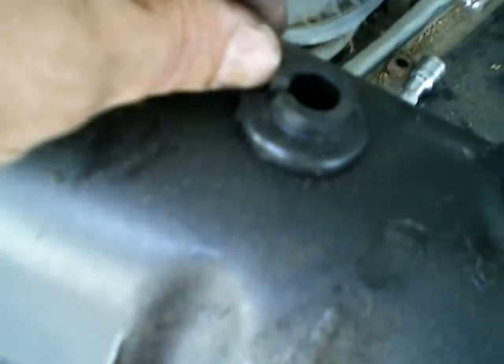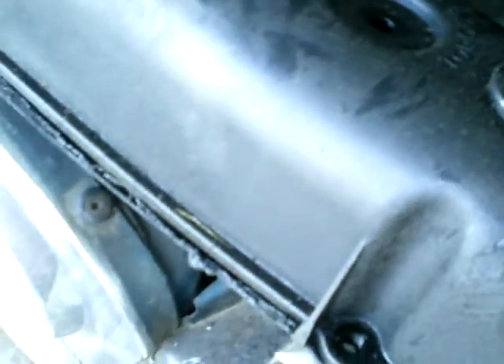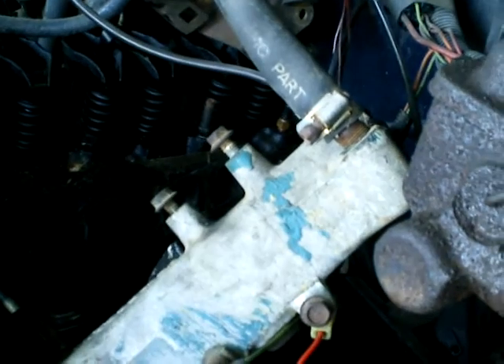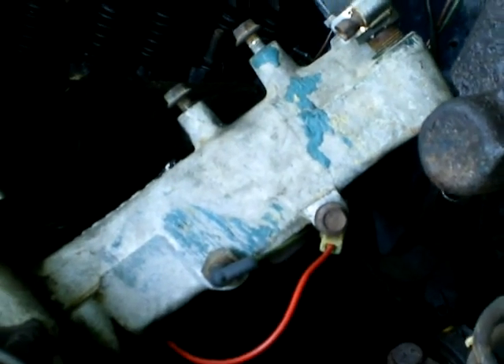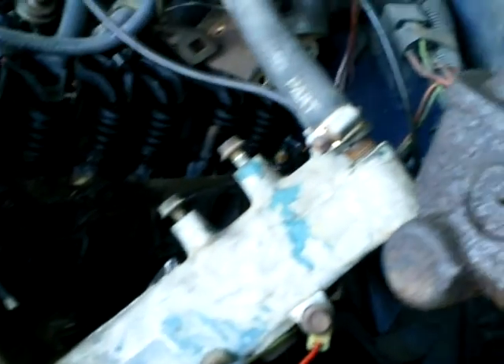If some minor stuff like that's broken, what I'm going to do is — this is solid color — I'll probably just clean this up. I'm not sure what the normal Jeep colors are. I'd like to paint the side of the engine that's exposed before putting all this back together. Looks like somebody had a light blue coating on the aluminum intake. I'll probably just take the aluminum intake off, clean it up, and clear coat it with a high-temperature clear coat. Then start putting this all back together again.